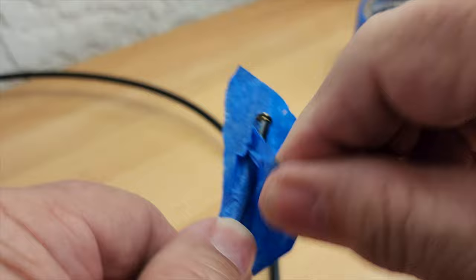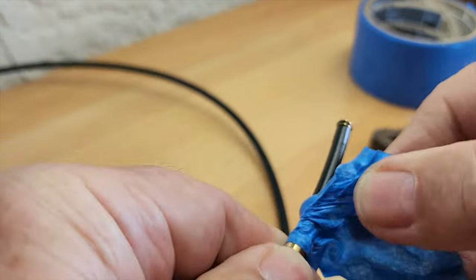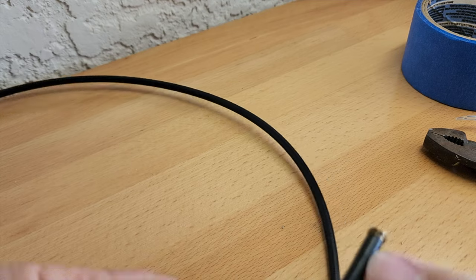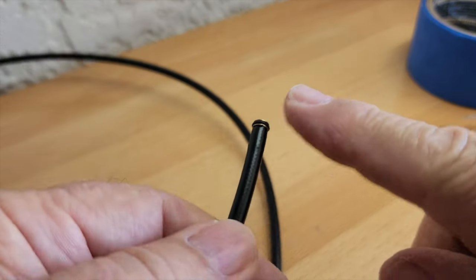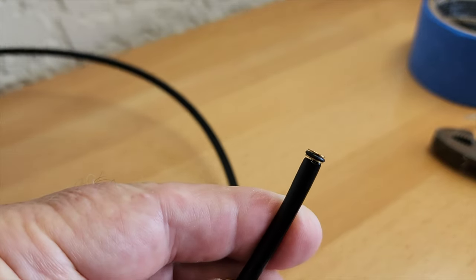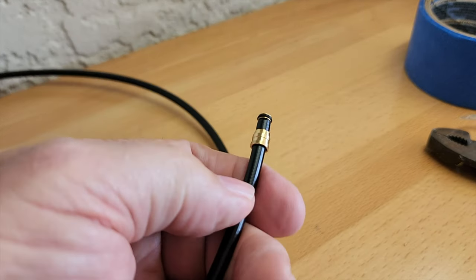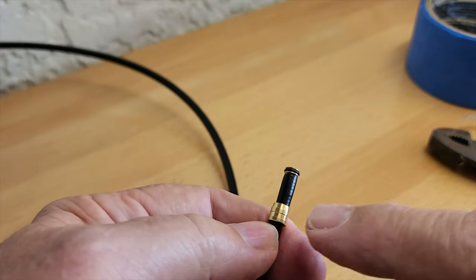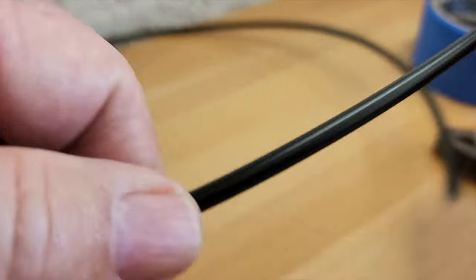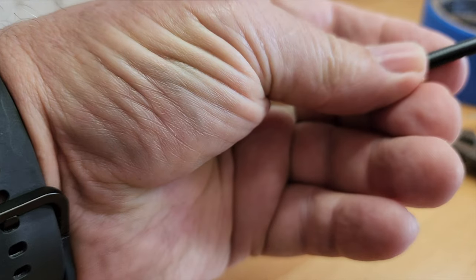Now, I love special tools, and if you want to buy a special tool, I advise you to buy a special tool. But this brake line, if I can get a focus here, came out beautiful. And that's all I did. Put it together, tighten up the ferrule nut, it'll squeeze this down. Actually, I put this on backwards, flip it around the other way. This is for demonstration purposes only. In fact, I'll turn it around right now just for the visual.